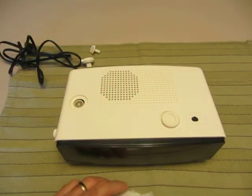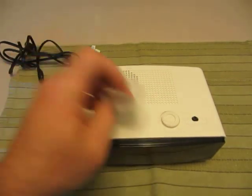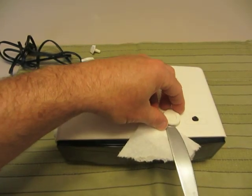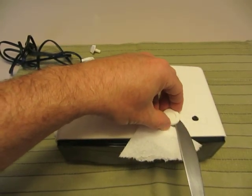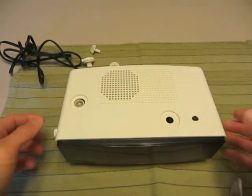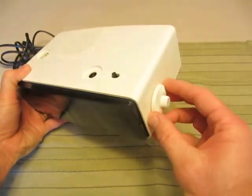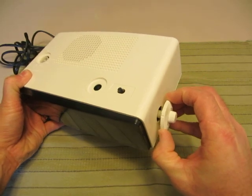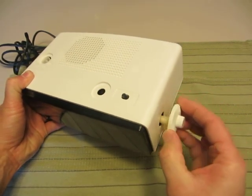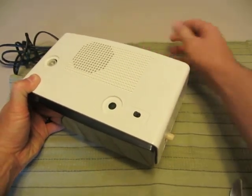This one here tends to be a little bit of trouble. I'll take my special tool and just a little piece of paper towel so I don't mar the surface, and just gently prop that up. If it's not coming off easily, take your time — go around there and it will come off. The sides: this is the dial for the radio, and you've got to pull that off. Sometimes in the older ones you'll have to use a little leverage. Everything comes pulled straight off — don't go at an angle and don't be in a hurry. They will break.